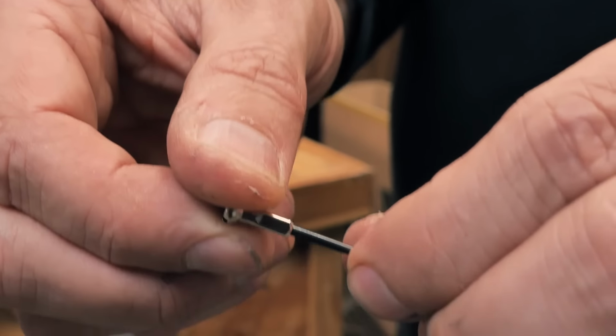Then I have these 2 gauges here. One is checking the true left to right and one is checking the true up and down, like whether it's egg-shaped or not. Now, there are certain standards for this, and there's also the unspoken rule amongst wheel builders. I'm going to tell you what it is. If you're doing a national apprenticeship with us, you need to be able to build a wheel to 0.2 millimeters accuracy on both dimensions inside 90 minutes, just to give you an idea of what our apprentices do here.